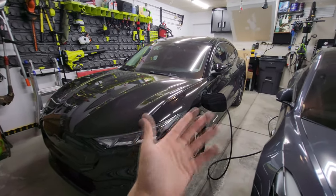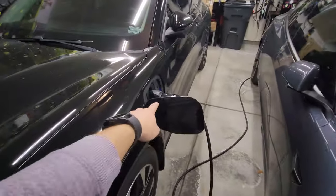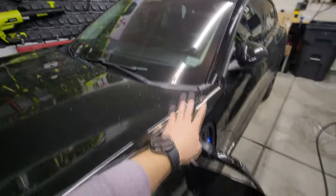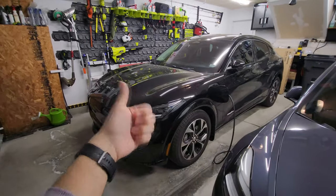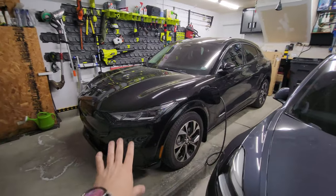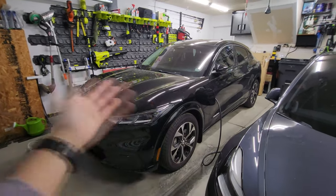It doesn't come without its quirks and does have some issues, but overall the car is pretty solid and we enjoy it very much. We've got our vehicle charging right now. We have our Tesla Universal Wall Connector on the wall that is currently charging our Ford Mustang Mach-E at a rate of about 11 kilowatts or 48 amps. So we're fully maxing out the vehicle and the charger right now. We're going to get it up to about 80% tonight. Tomorrow morning I'll hit the button and charge it as far as we can get it before we leave. No matter which way we look at it, we are going to need to stop. Let's jump in the car and take a look at the map.